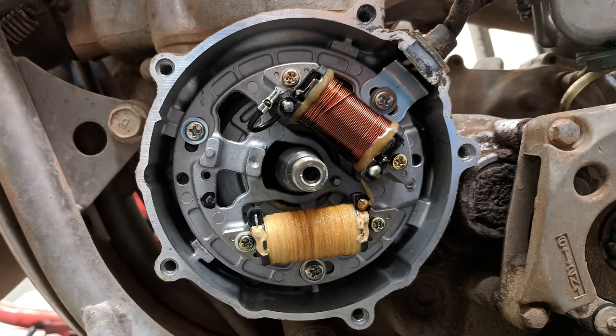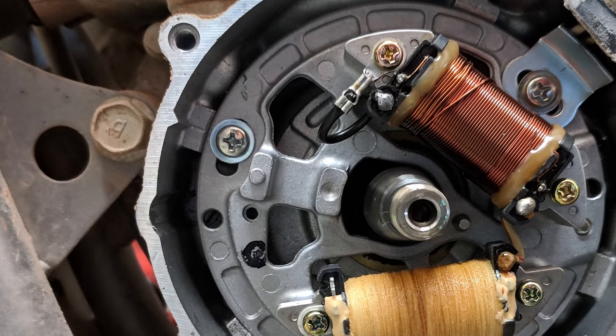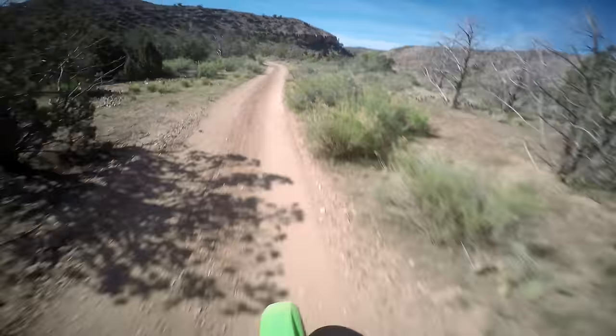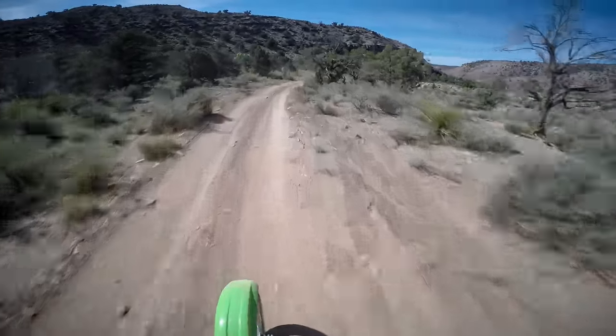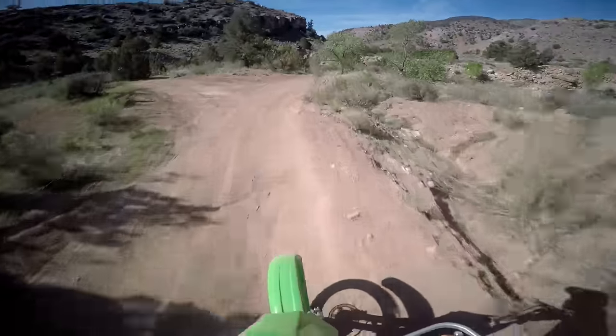The lighting coil can also be wound to output up to 75 watts AC, which is plenty for a dirt bike. Since the lighting is powered by a single little coil, it's simple to rewind — anyone who's up for a simple project can rewind it at home. The stator plate on the KDX also has slots instead of holes where the mounting bolts go through, and a small set of index marks, so the stator plate can be advanced or retarded a few degrees to shift the ignition timing. To me it seemed already optimal at the center position, but it's still cool that Kawasaki provided this feature, as none of the other bikes I've reviewed had adjustable ignition timing as a stock feature.